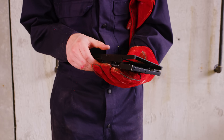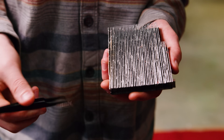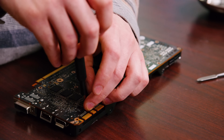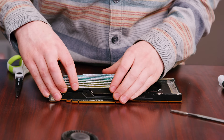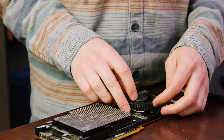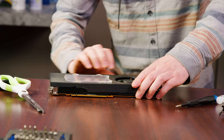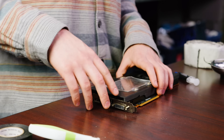With the heat sink now at the right height, we just had to remove any loose bits of aluminum — because if one of those crosses the traces on the PCB, it's game over — and then slap it all together. It's actually a little bit easier to assemble now than stock since there are way less screws. The fan mounts with some strong double-sided tape. The see-through panel had to be glued onto the outside instead of the inside like on the original model, to maximize the area of the fins — having the glass on the inside would have meant about 20% less cooling. Unfortunately, when we went to test it, the fan wouldn't work, possibly because of the grinding.